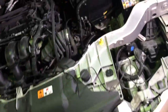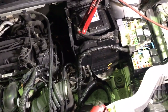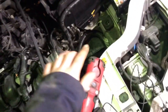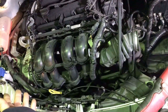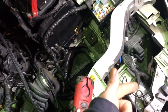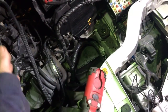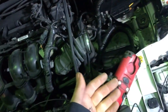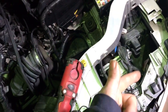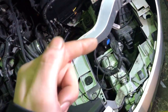Once bridged, the battery light was gone, fault codes were gone, and the grill shutters were working fine. There's clearly a breakage somewhere in that wire, which is strange because I did a continuity test between the alternator plug and the loom join — perfect continuity, very little resistance. I also tested between the middle pin of the grill shutter plug and where it comes out of the PCM — perfect continuity again. But bridging the signal wire directly from the alternator to the grill shutters solved every problem.